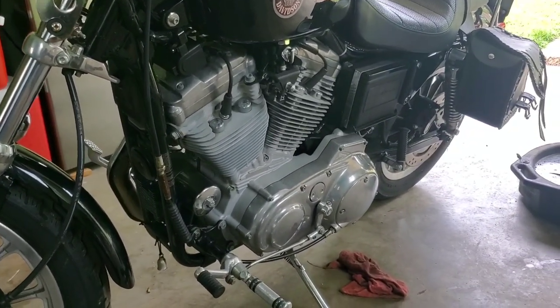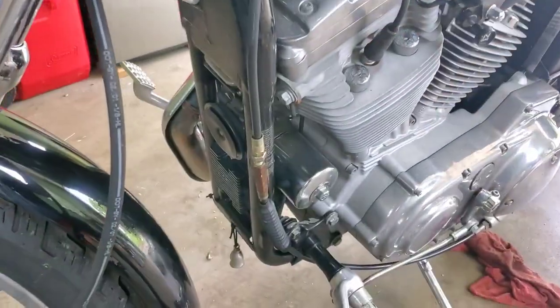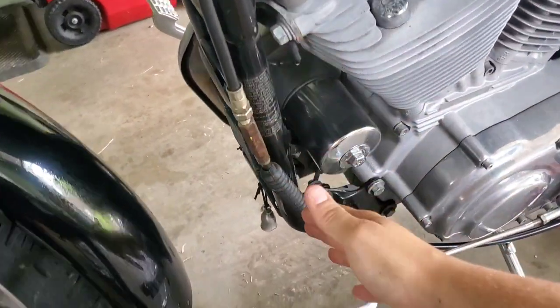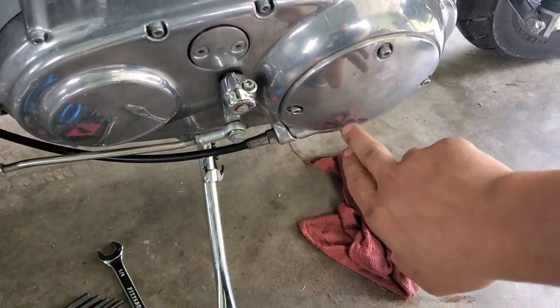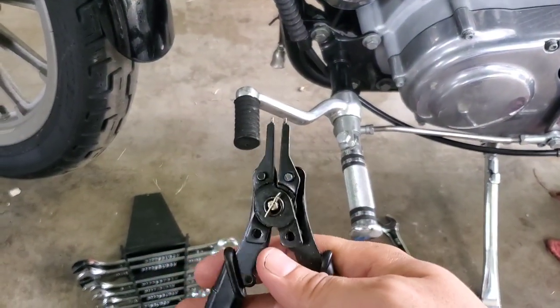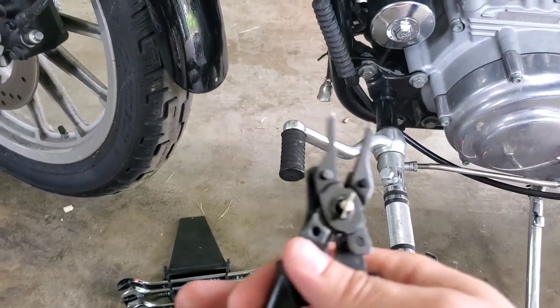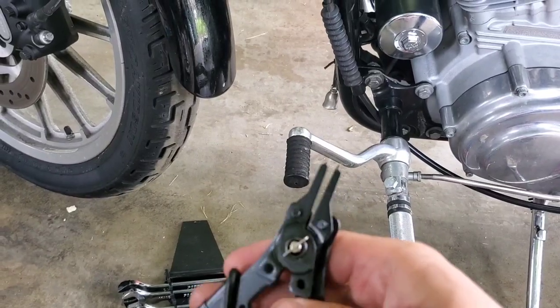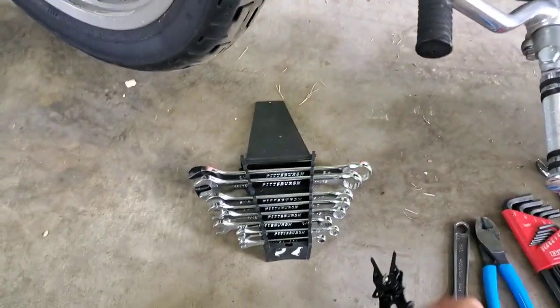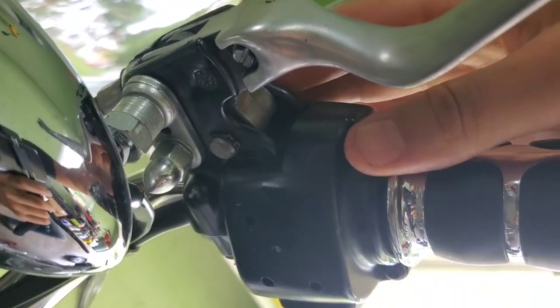Some of the things involved in this task: you've got your clutch lever, your clutch cable, and your derby cover — all things we'll be dealing with today. Another thing is snap ring pliers. They're very handy to have on this task. Although you don't need them — you can get by with a screwdriver — they do make it a lot easier. They're used for the pin on your clutch lever, which is held in by a snap ring.